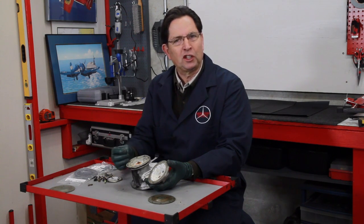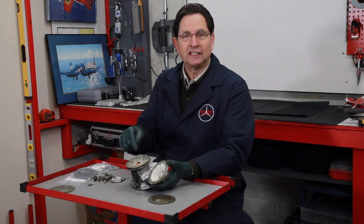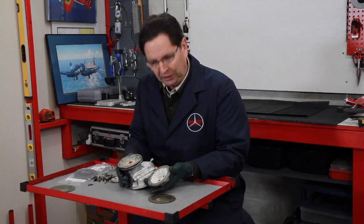The pump is probably still usable, but it's going to require a good cleaning. So when you pick up an old Benz and you want to save it, obviously the things you have to look at are the fuel system — you're going to have to drain the fuel, replace filters, replace hoses, and almost always you'll have to redo the brakes. But for those going after an old diesel, consider also looking inside the vacuum pump if the car has sat for more than three years.